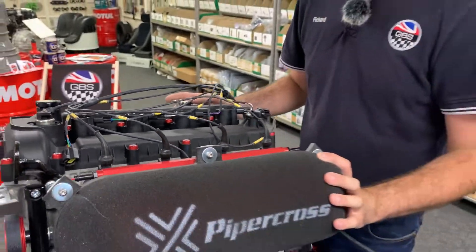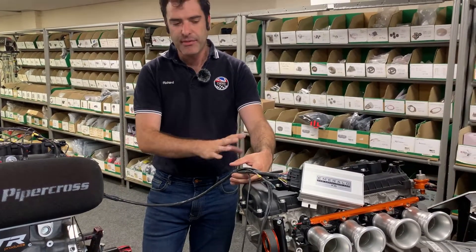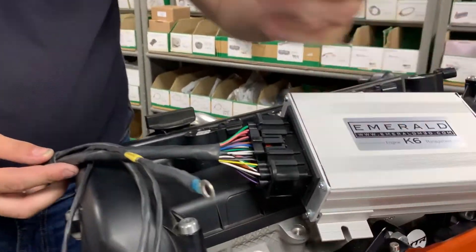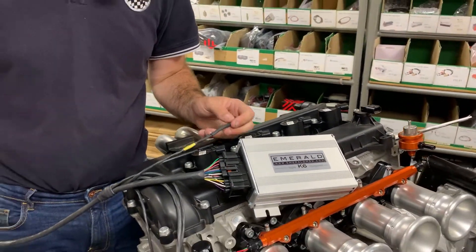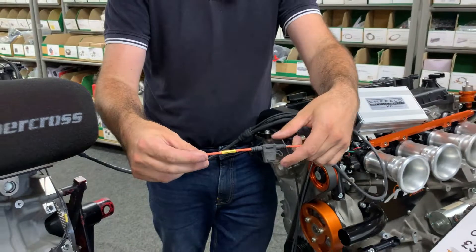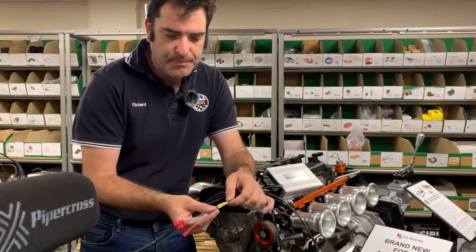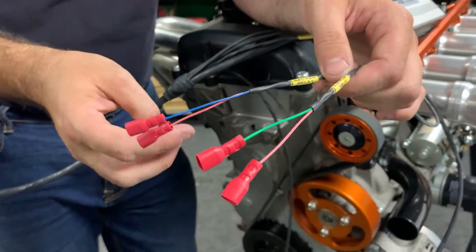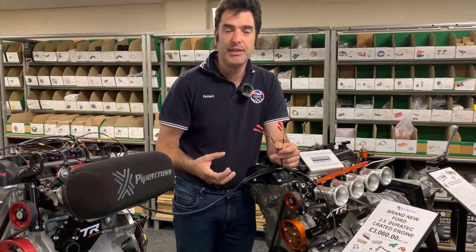We've got all the wiring diagrams, all the support throughout. If you do get stuck, there's a decent length of loom to go through your bulkhead and mount the ECU inside the car. You've got your ECU connection plug, a chassis ground — this wants to be a really good earth on the body and you need to make sure you always put an earth strap to the engine. Then you've got ignition power with an inline fuse. You've got your fuel pump relay and fan relay — these are switched earth outputs on the Emerald to switch the low side of your relay, and then it's up to you to connect the high side to control the device.